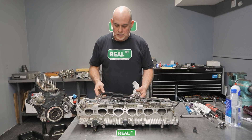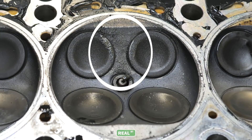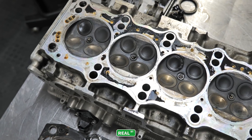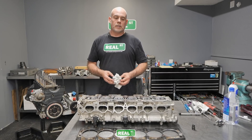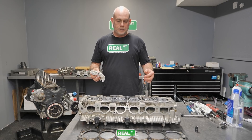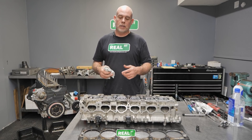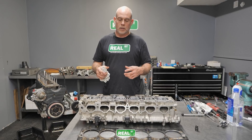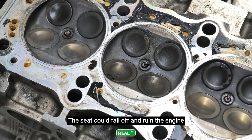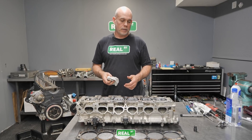There's a decent amount of aluminum that's been eroded from the chamber. When you compare any of the other chambers with chamber number five, the area between the exhaust valves is eaten away and it's plastered all over the combustion chamber. So this head is garbage, which isn't a huge loss because this head had been with those guys for quite some time. We had resized the cam journals before, and at some point you have to acknowledge the racing parts are just used up. Welding around the seats is a bad idea because the aluminum changes its temper — it goes soft — and while that would work for a general repair, it'll just ruin the head moving forward. So this head will now go into the garbage can.